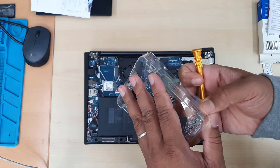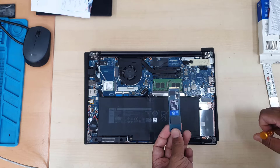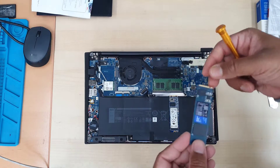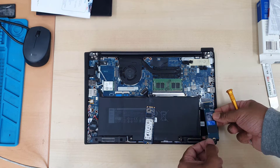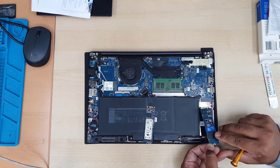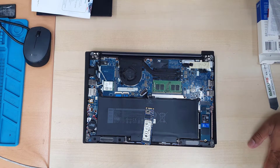The new one I have is an M.2 NVMe from Western Digital. Both have the M.2 form factor and M.2 connector, but the technology is different — one is NVMe, the other is SATA. Both are fully compatible with this slot, but NVMe is much faster than M.2 SATA. We connect it the same way, secure it with one screw, and it will be ready to take Windows 10 in UEFI format.